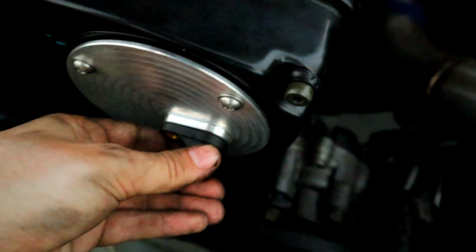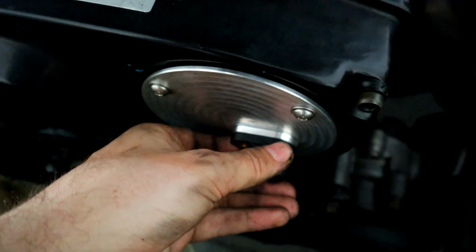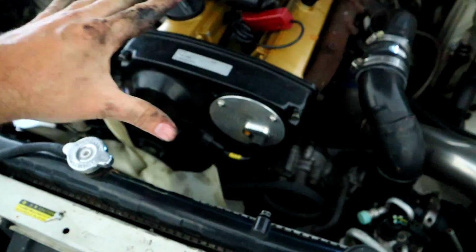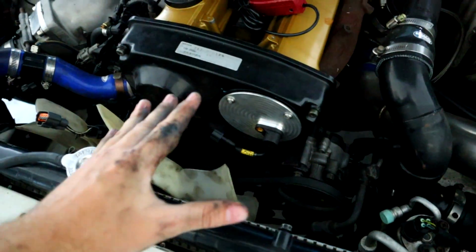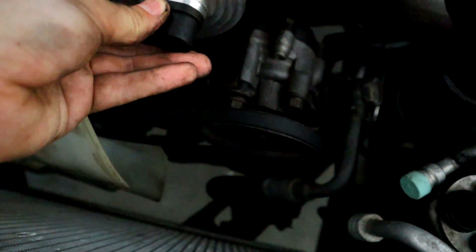So what you need to do is put the sensor in. This is the way that Sam sort of described it. Onsong Performance actually physically measure the depth of it. I'm not gonna do that. I do have a set of calipers here, but I don't have any shims. And if you guys can see, when we push it in all the way, there is absolutely no gap whatsoever in there. The sensor moves completely fine in there. We're not pressing up against anything.